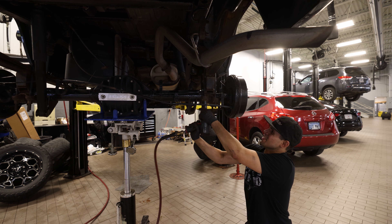I'm going to be replacing the rear leaf springs on both sides, so I'm actually going to remove both of them. I don't know if it's going to be easier installing the Add-A-Leaf while it's out or while it's in the truck, but I think I might try to knock it out while it's out of the vehicle with the new leaf springs and go from there. We're also going to need to remove this trim piece that deflects debris from the gas tank — this will give us more clearance to get to the bolts for the rear leaf springs.